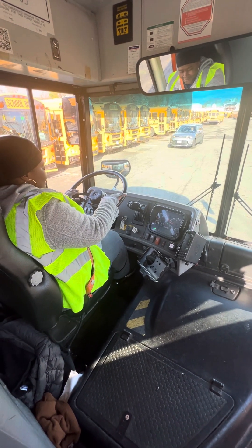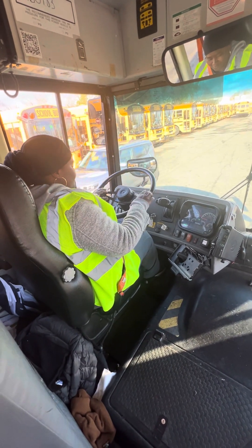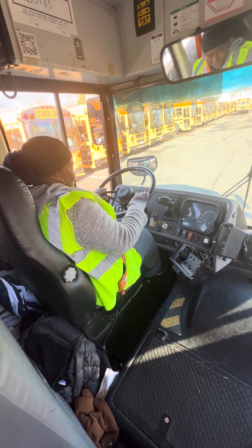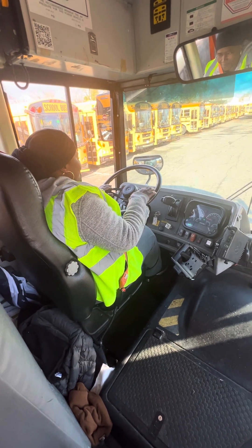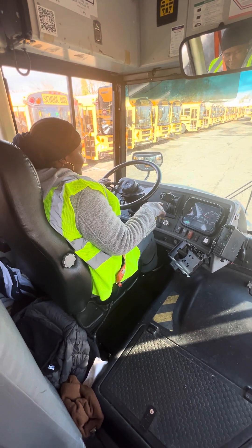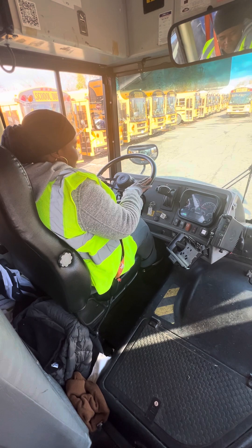Now you want to check the spring brake. Now the needle is on 60. I'm going to keep pumping — it is going to come between 20 and 40.